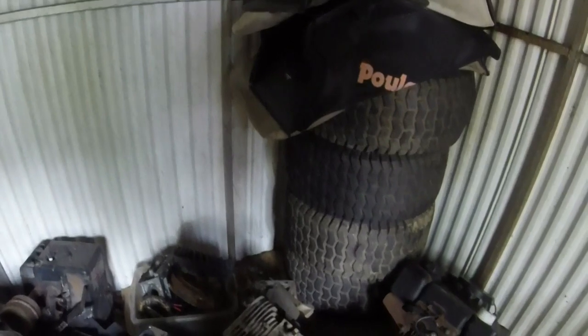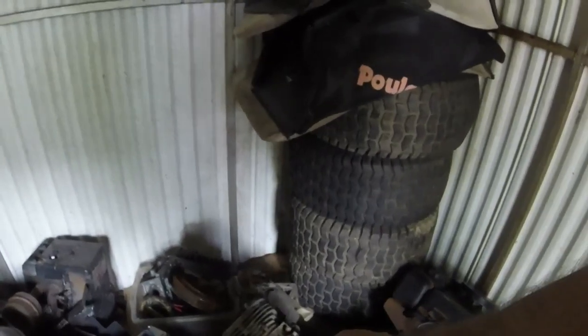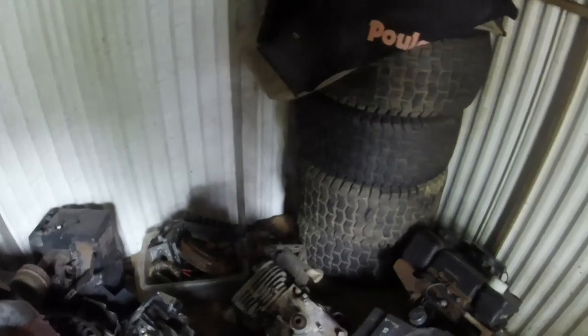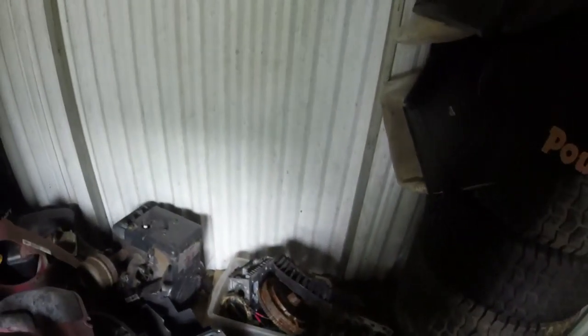So this one might work, as long as I have the correct flywheel, and I'm not sure if I do or not back here, but I do have one off of another mower that would work. So I could take this engine block, theoretically, throw a head on it, a couple of push rods, and I think I'll be good to go, honestly. This is the original block that came on this engine. We got the coil sitting over there.